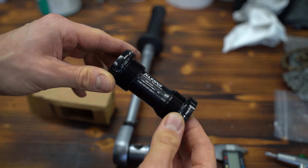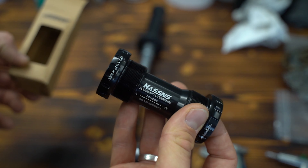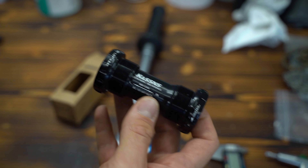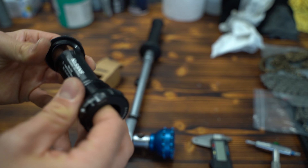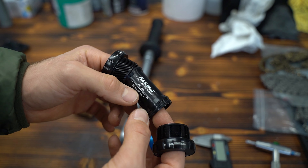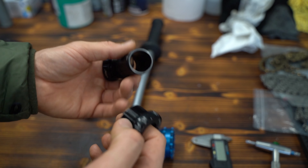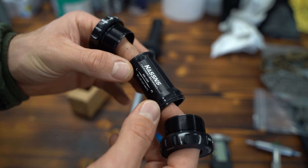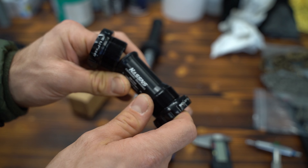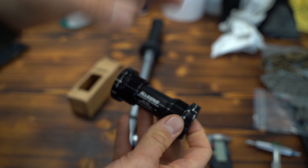What I got is this bottom bracket right here, which is BSA 24 millimeter axle. Hassan seems to be the brand — never heard of it, of course. You can read on here: ceramic bearing. Then you can see we have this protection that normally is made out of plastic from Shimano, but this one is also metal, which is kind of nice — will be a bit heavier. We have nice seals over here, so the first impression is actually pretty good.